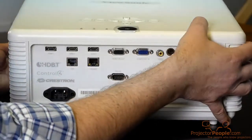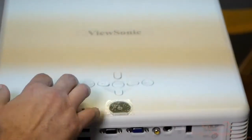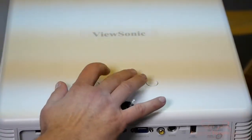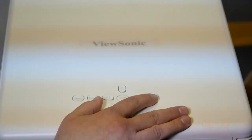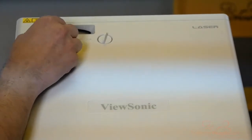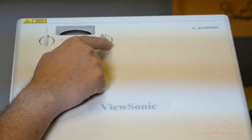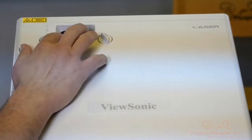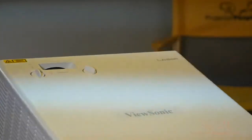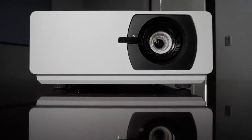And then if we take a look, I don't know what they've been feeding this thing, but it is kind of heavy. We have access to all the menu items from the bottom of the projector, which will wind up being the top if you install it. Menu, source, easily switch between all that, and then 4-corner keystone correction, and that's probably auto keystone there. And then here we have our fine lens shift. We have around 11 or 12% vertical lens shift, which is this one actually. And then you have around 5% either way lens shift for horizontal. Vertical is always what you want more of because it's probably going to go down like that. And then you have your zoom here. And then on the front of the projector, you have easy access to your focus. So that's super smooth. So let's take a look at this thing in action and see how it looks.